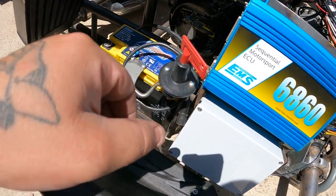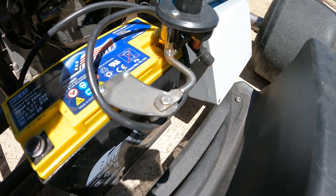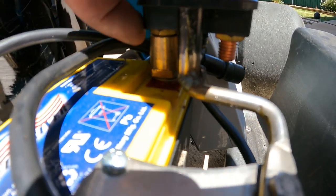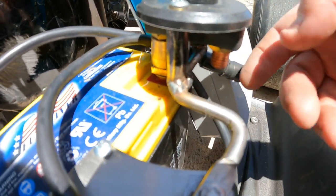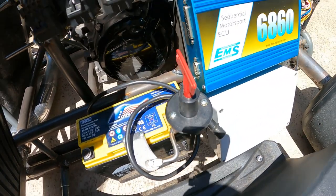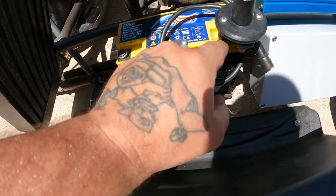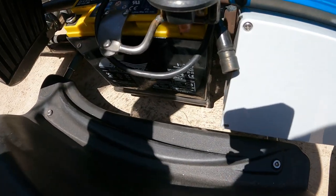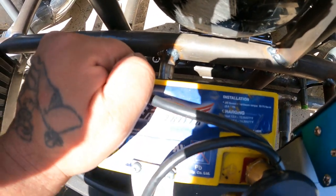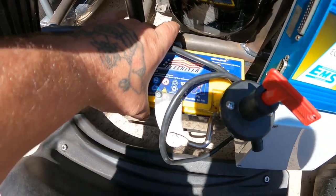With the battery itself I needed to put a battery switch on there. I didn't want wires coming off it, so I've actually tapped the lug — the battery switch actually threads into the lug, so it's joined straight onto it. Then we have an M10 off the other side of the switch, so it's mounted straight onto the positive terminal. I've never done it before but thought I'd give it a try. I didn't want to snap the terminal off, so I've made up a little bracket here to keep it nice and solid on the battery, plus a little tab to keep it a bit further forward.